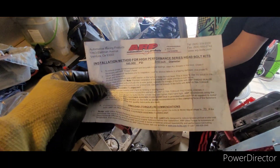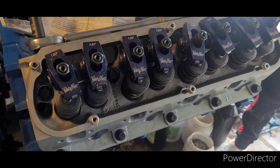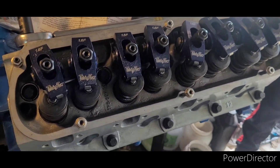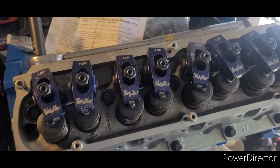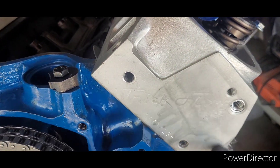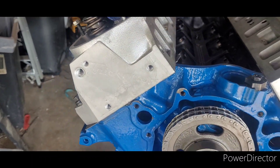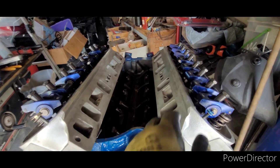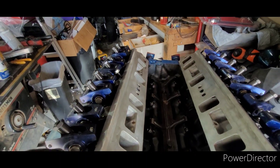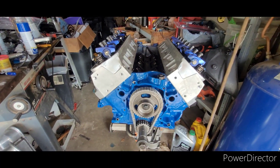I really don't want any water leaking out of the bottom bolts, and that's how we built Junior's engine. This is our 30 foot-pound sequence, then we're going to do 50, then 70 according to the ARP specs, and hope nothing breaks. Head number one is on. I couldn't film the full torque sequence because I had to hold the engine stand for Junior to get them up to 70 foot-pounds. Both heads are on and torqued down. There were some nerve-wracking moments every time a bolt spun just half a second more than I thought it should, but both heads are torqued down and double checked.